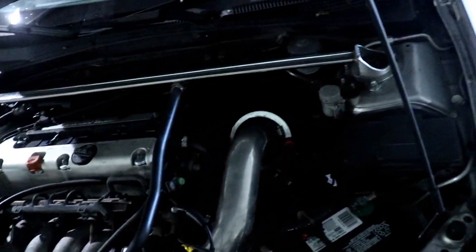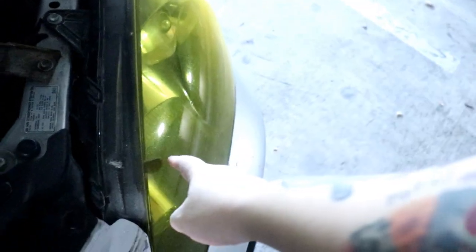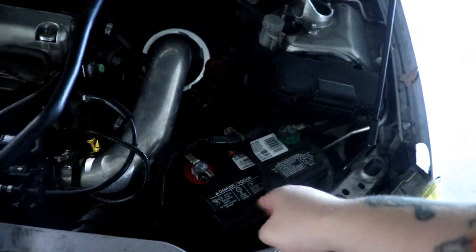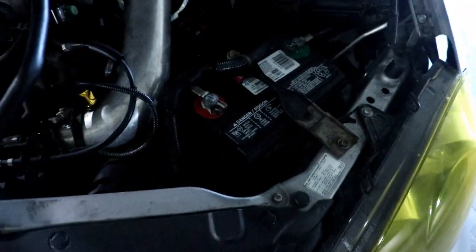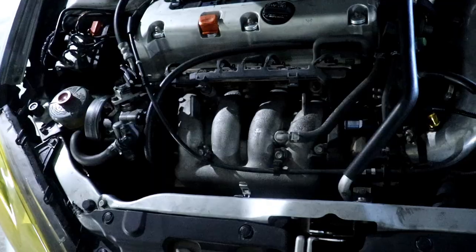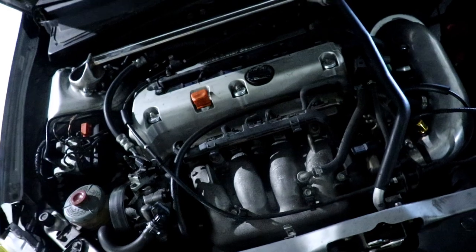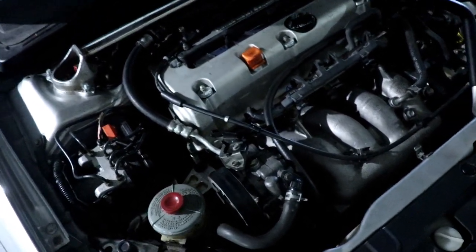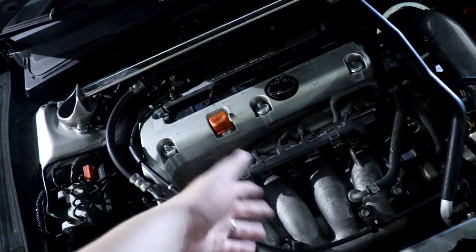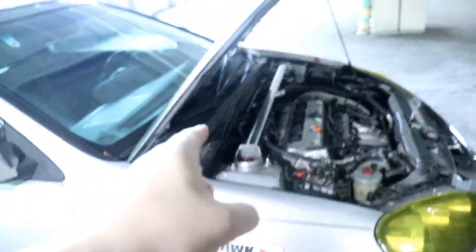On the transmission and the OEM shifter — you can look those up on my channel. I did like Hybrid Racing springs and stuff like that. I do plan on getting a custom made headlight inlet, relocating this battery somewhere probably in the back, and custom making a short ram intake that goes right behind the headlight so I have an efficient cold air intake setup. Then I want to change out the OEM intake manifold to an RBC, and do an aftermarket fuel rail with bigger injectors, then tune the car with K-Pro. I'm still considering deleting my power steering and I want to keep AC for as long as I can.